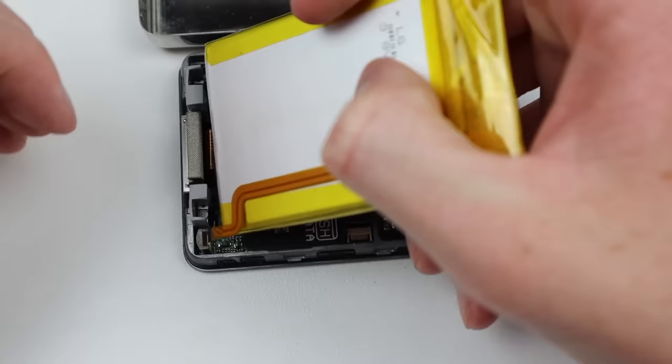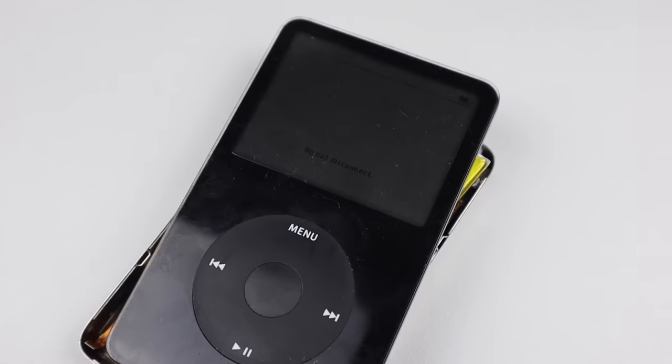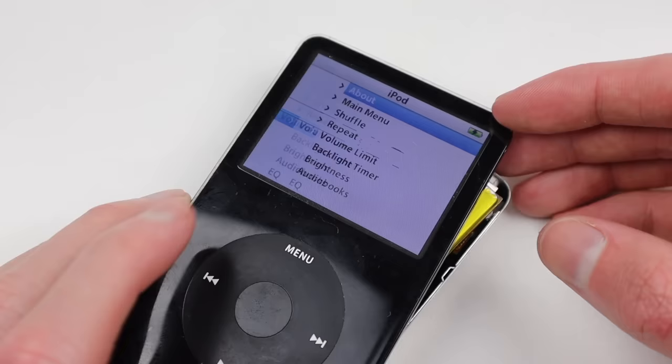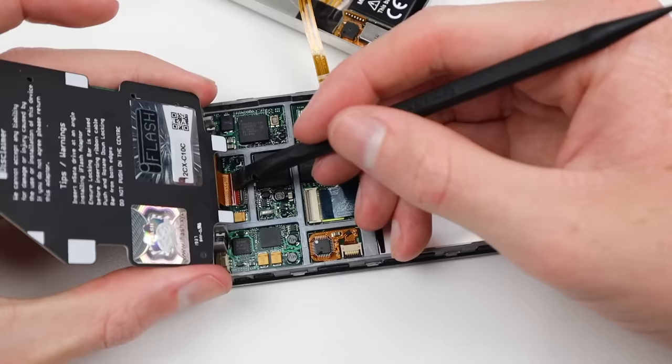You can see just how big the 3000mAh battery is — it doesn't fit where the old battery sits as it's significantly larger, meaning I'll need to make room for it. Plugging in and testing, the iPod shows the 'connect to iTunes to restore' screen, which is exactly what we want with a fresh disk installed. After restoring the firmware in iTunes, the iPod is up and running. The display has some dead pixels so I'll need to replace that, but in the about section it has detected the 256 gig SSD.